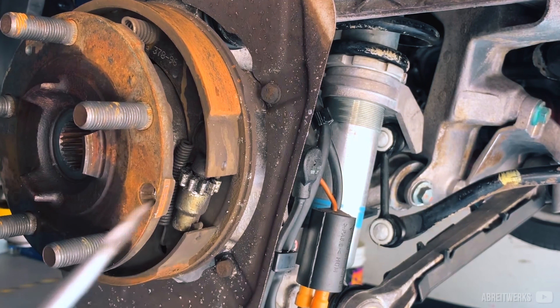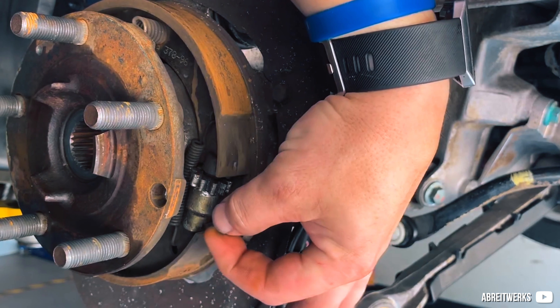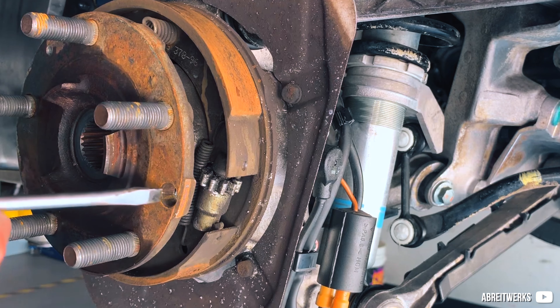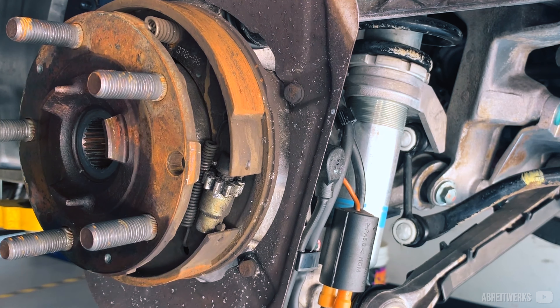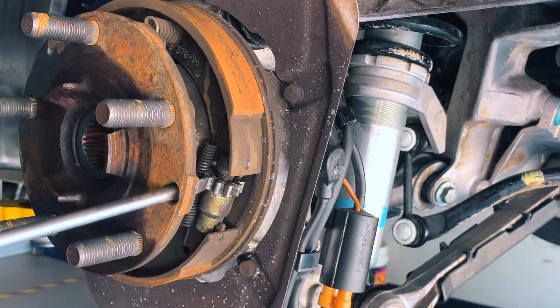So I thought that maybe the adjuster — it is called the self-adjuster — self-adjusted. On many cars, not just Porsche, there is this tooth wheel which pushes those pads away from each other, acting on the inside of the brake disc like it would be a drum. It is possible to do it from a wheel bolt hole, but it is easier to take down the disc.